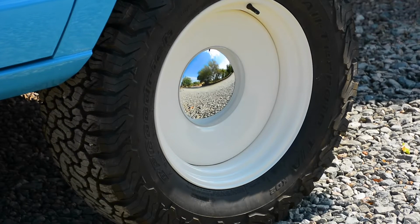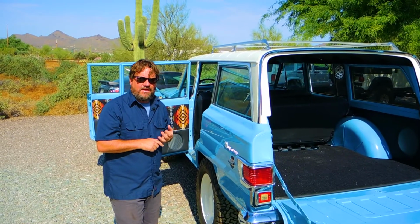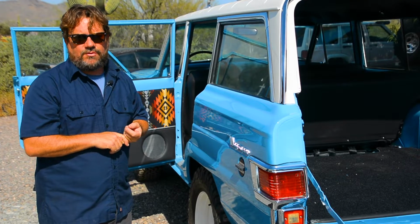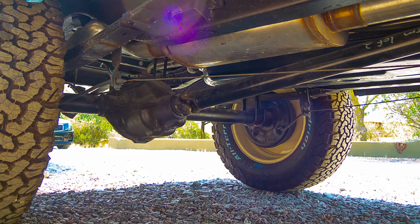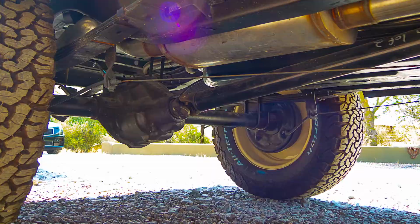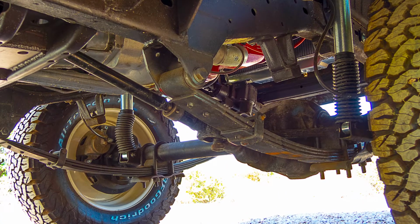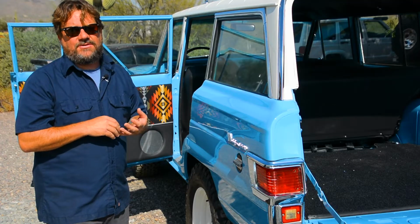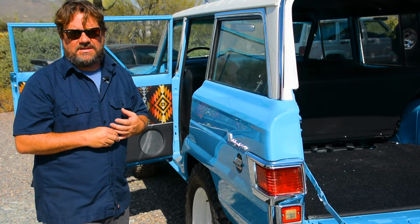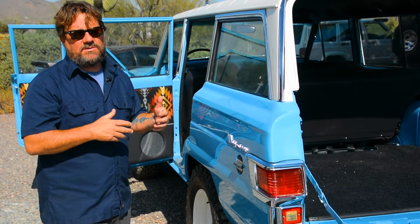We did custom made 18-inch Detroit steel wheels. These Wagoneers come with a two-piece 44 rear and then a closed knuckle 2730 front. So we actually converted this to late model Wagoneer axles. So these are all 1980 Wagoneer 6-lug front and rear 44s, which got us the disc brakes and actually solved a lot of issues, relatively inexpensive, which was getting rid of the two-piece rear and gaining disc brakes with just a set of junkyard axles, which we refreshened.